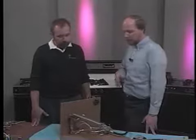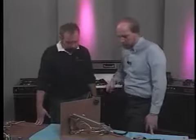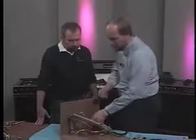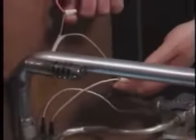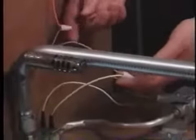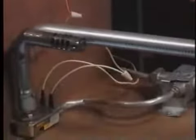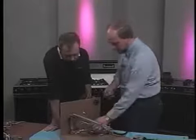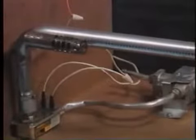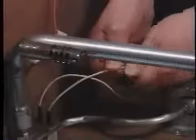But if you go out and it doesn't glow, the quickest thing to do is kill the power to the range and use an ohm meter. Most of the glow bars out there are wire nutted. Some still come from the factory with plugs, but a lot of them use wire nuts, and the repair igniter will come with wire nuts. So if the glow bar is not glowing, what we need to do is break this connection right here. Of course, kill the power first, and here we can just flip the switch since we're on a variac. Okay, disconnect your leads.